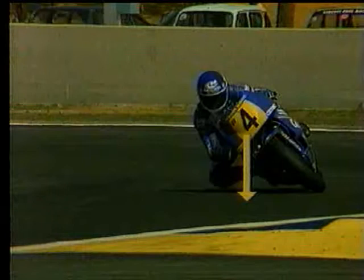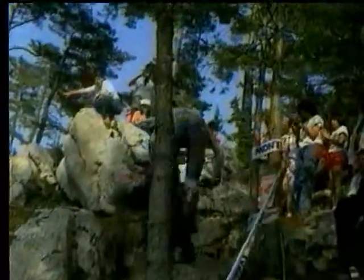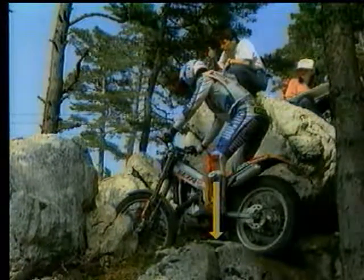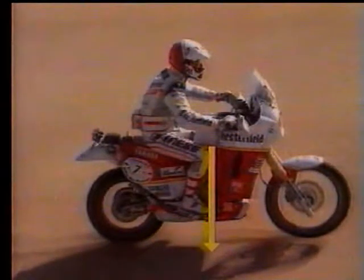The height of the center of gravity also affects a motorcycle's behavior. Weight alone is not the only determining factor in maneuverability — the position of the center of gravity also has an impact. Road holding characterizes the motorcycle's behavior in its various phases: acceleration, straight-line braking, cornering, and sensitivity to road surface excitations. This is where the work of the tire-suspension assembly comes into play.